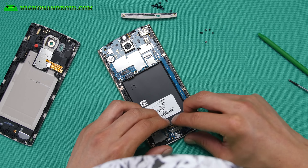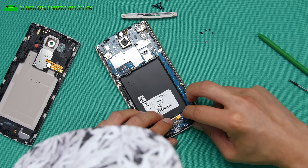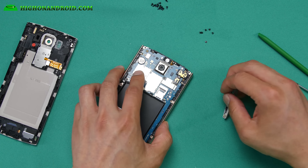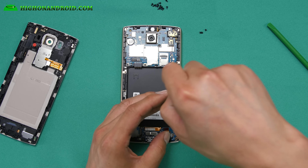Go ahead and do the LCD plug here — whatever is the biggest flex connector is usually the LCD. Just pat it down. Next, we're going to go ahead and put the front tab on — align the two tabs and it should just pop in there. Then we're going to do the screws for the steel rails — the first three screws from the top. The screws for the rails are actually smaller, so make sure you use the small screws. Third one there.